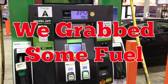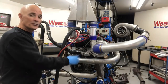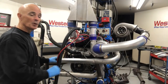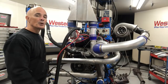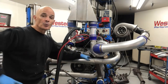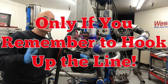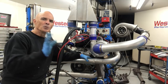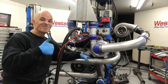I think we've got everything hooked up. We've got all of our exhaust routed from the Y-pipe into the small turbo, the exhaust going out of there feeding the big turbo. We have this secondary pipe coming from the wastegates controlling the small turbo, feeding all that exhaust from the wastegates up into the big turbo. We have two wastegates down here, both with 7-pound springs. Right now we've got a wastegate reference line directly to the tube with no controller on any of them. On the third wastegate I have a reference line going to it — that wastegate also has a 7-pound spring. We're going to try that and see what happens. I'm concerned all the wastegates are the same size so we may have too small a wastegate controlling the big turbo. Maybe we have a rising boost curve. Let's try to start it.